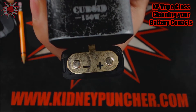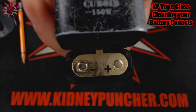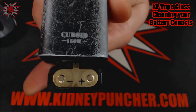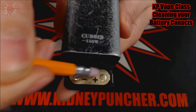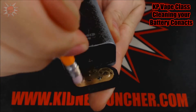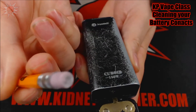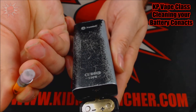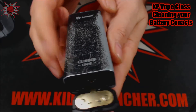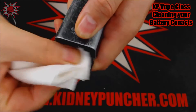You pop this down and as you can clearly see, my contacts are just completely filthy, just completely annihilated. The easy way to fix this is you take your eraser and just kind of run it along your contacts. You can see the tip of that pencil is now all covered in that junk. Next step is I'll take a rag or paper towel and then I'll just wipe off the little excess residue that's on there and give it a nice polish.